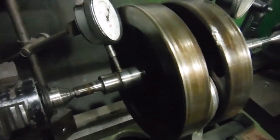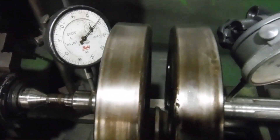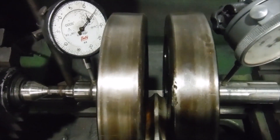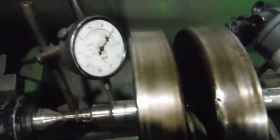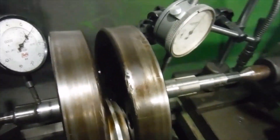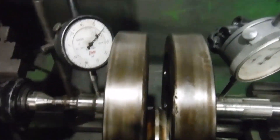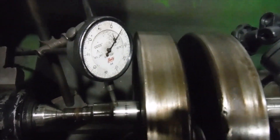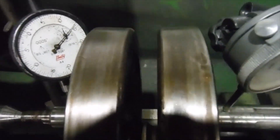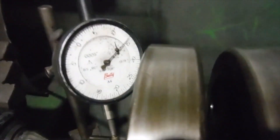Here's that Royal Enfield Redditch Bullet 350 crank again, and I've rebuilt it with a replacement big end — crank pin, floating bush, conrod, and outer race. It's all back together now and I've trued it. I'm very happy with what I got, bearing in mind that this one had some five and a half thousandths of an inch runout on it as it was when I took it out of what had been a tired but running engine. Both gauges are reading in thousandths of an inch.